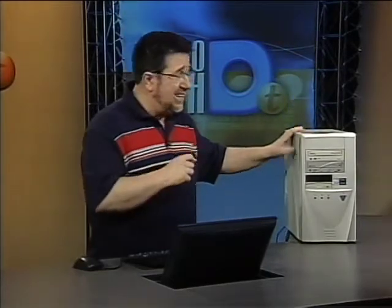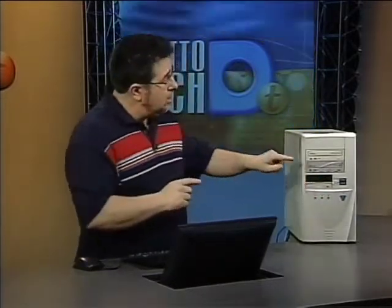What we're going to do now, because this is a bootable CD, is boot this old computer from the CD. This is really probably the most technically difficult part of the entire conversion process over to Linux. If I just turn this computer on, it will automatically look to the hard drive where Windows is still living and boot into Windows — which won't do us any good. What we need to do is tell the computer to boot off of the CD-ROM drive.